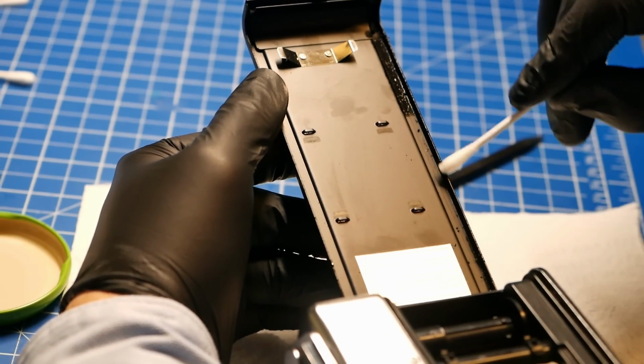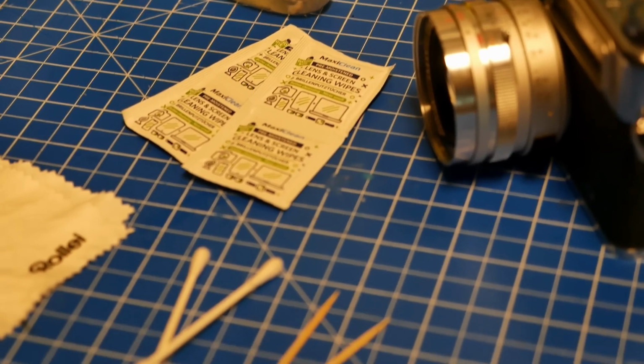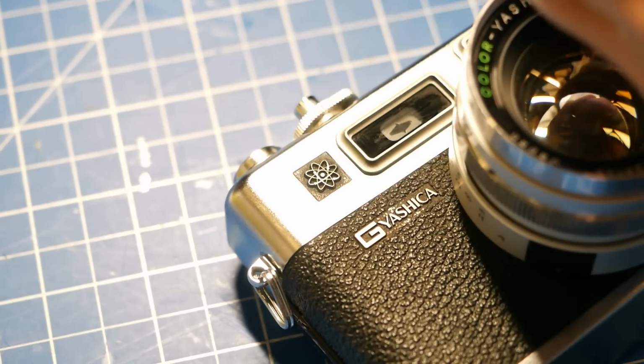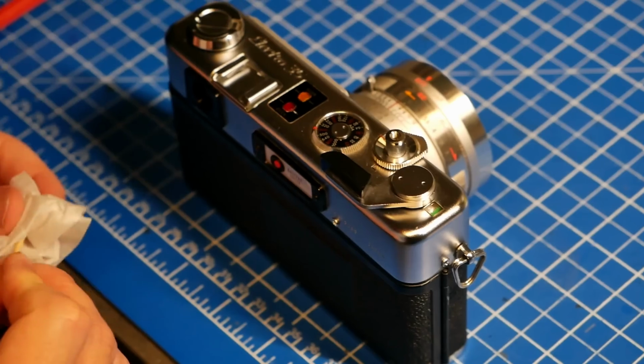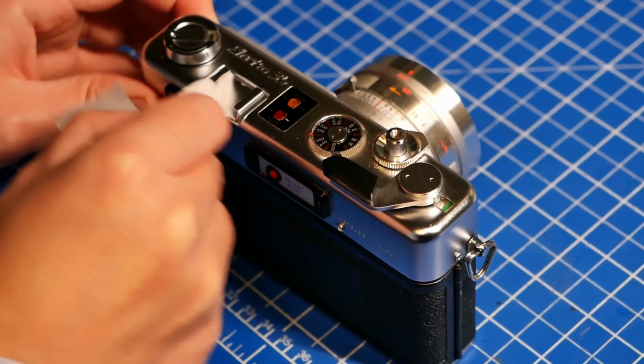And then he also showed me specifically how to clean the optical elements using basically glasses wipes and a dry lens cloth in combination, as you would typically know and do it as well. But it was interesting to then combine it sometimes with toothpicks in order to get into every corner of, for instance, the rangefinder window or the viewfinder window. I also found that interesting, and how easy it can be if you have the right tools. And I saw quite a difference between my initial clean, which I considered pretty good, and then after what I had learned and applied, how the camera suddenly looked.